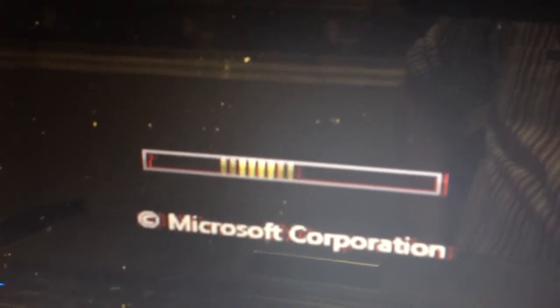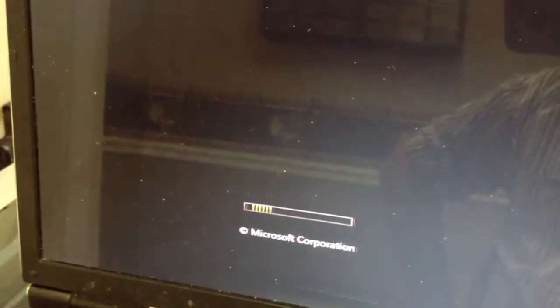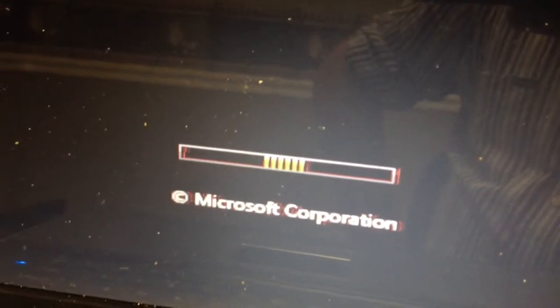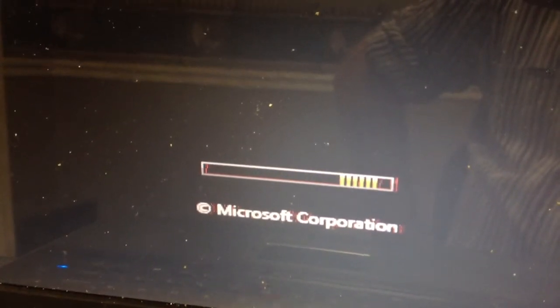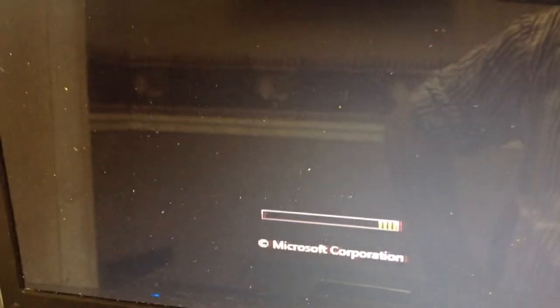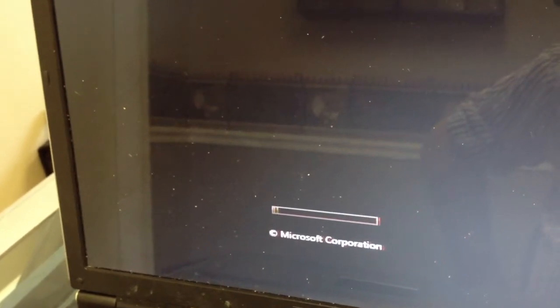You may ask: what's the difference, and how can you tell this isn't a GPU issue? First, it's only in the area where colors and words are being displayed — that tells you it's a frequency issue. Second, it's not across the whole entire system; that would be a BGA issue. Third, the red coloring tells you — back when we used to have inverter and LCD problems, you would get an orange or reddish-orange issue, and that would be due to a frequency problem related to the inverter, the LCD, or the video cable.